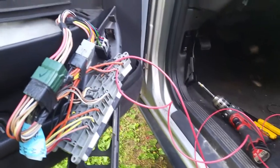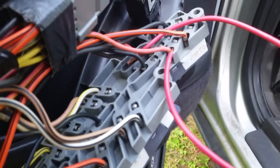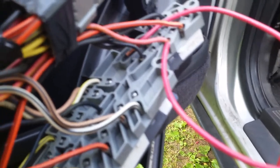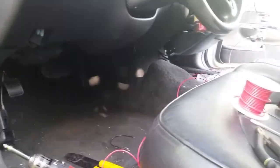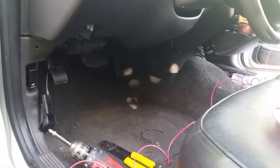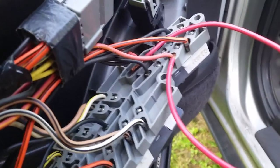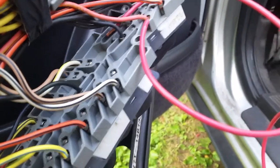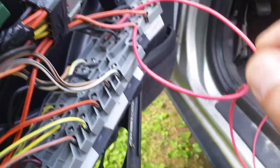Door lock mystery solved, sort of — still not 100% sure what's going on but I figured out what I need to do to make it work. There's a pink and yellow wire and a pink and green wire. Those wires are supposed to run from this side to the other side. They switch polarities when you flip the switch, so that's where things get confusing. They test through as if they're good, makes no sense, but they're not — something is open between the two of them.